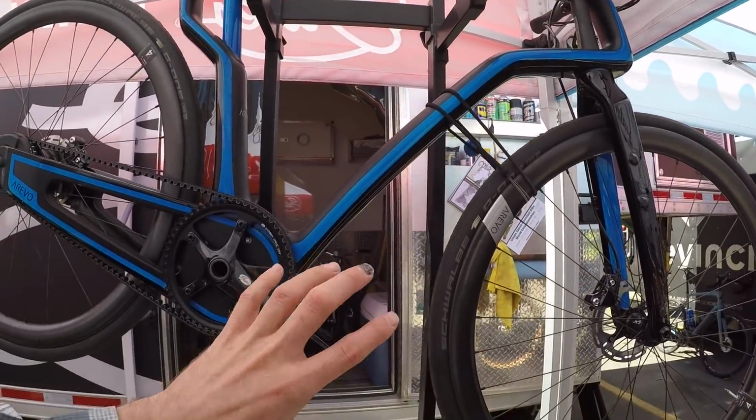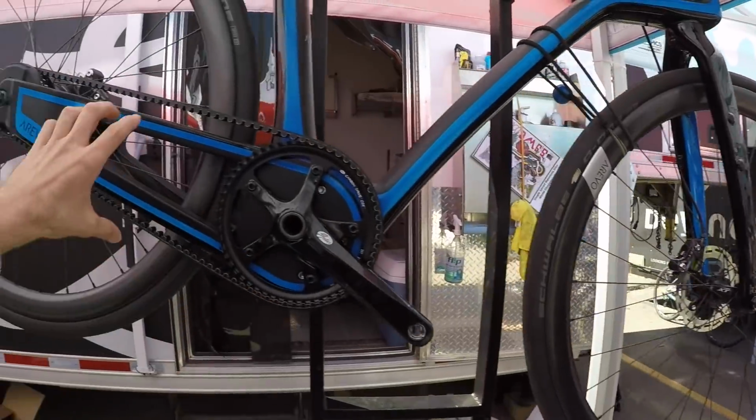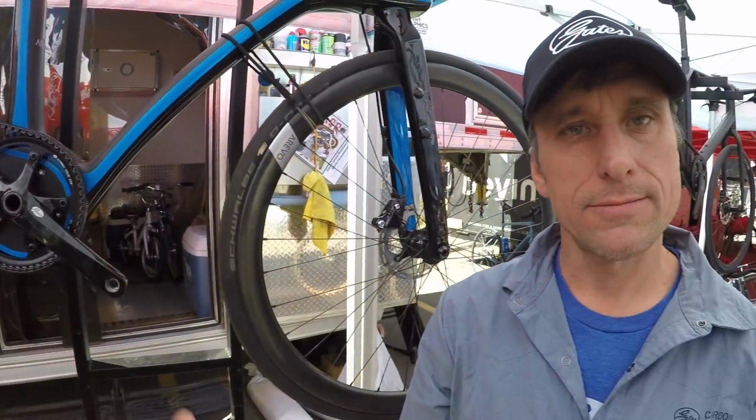It's really beautiful. While we were on the topic of e-bikes a minute ago, I have seen Riese & Müller and some of these other companies, like Evelo, using belt drives. People ask, why this versus a chain? And it's always, well, it's quiet and it's durable, kind of like a timing belt in your car. Even more durable than chains in some cases, but you have to have a frame that either doesn't have that extra stay or has a cut in the stay so you can get the belt on, because the belt doesn't come unattached. Can you just talk about the pros and cons, or sell me on Gates?